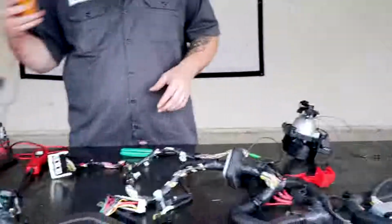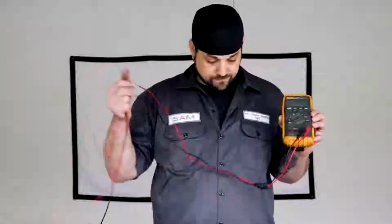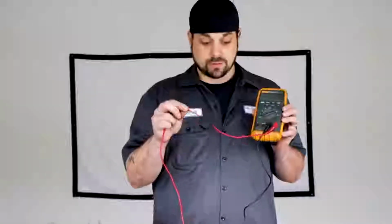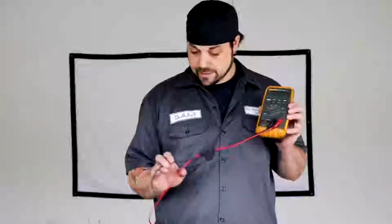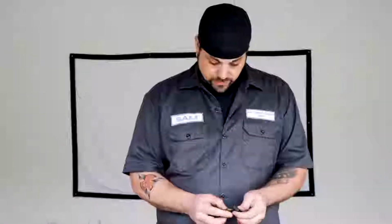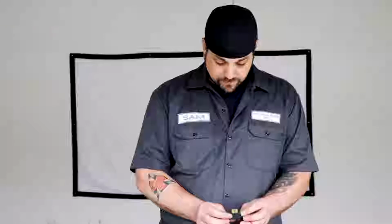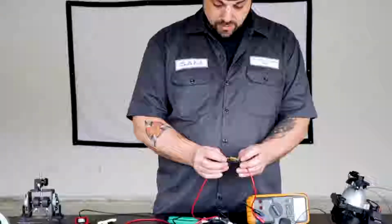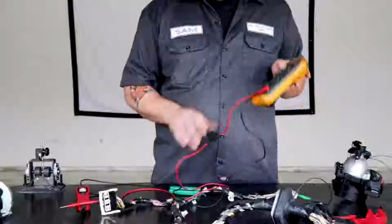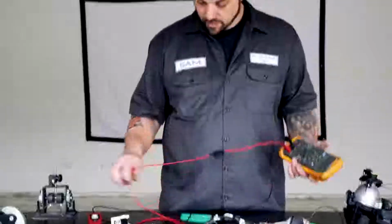First, everybody starts out with their own meter, right? Like you got the regular Fluke meter here. Just a note about the leads on the Fluke meter: if you don't have one of these, you need to get one. I believe they even sell it for the negative lead now, but all this is, there is a fuse inside of here, just a 20 amp regular sized car fuse. So it goes right in line with your test lead. That way, instead of blowing the $30 fuse inside of here, you can blow this first.